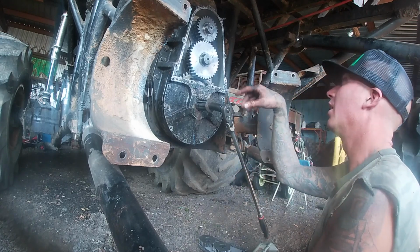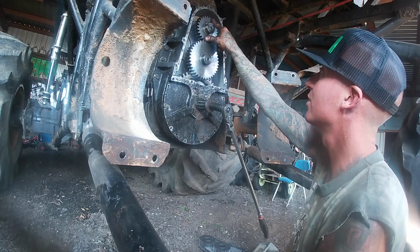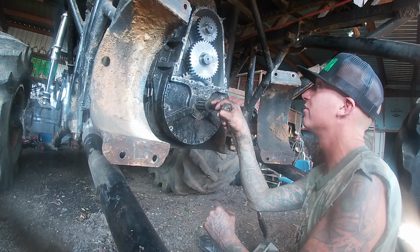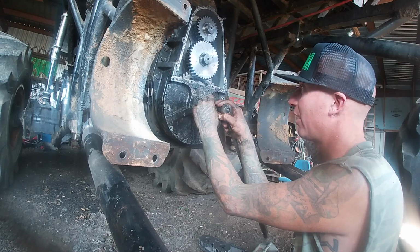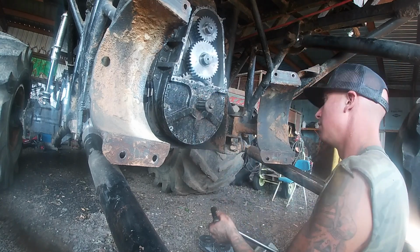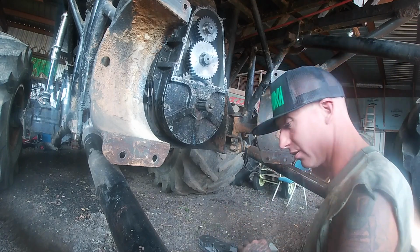So that set will allow me to go 2 to 1 with this gear on top, or 4 to 1 with this gear on top. The other set I had in there was giving me a 3 to 1 final ratio on the case. So this will gear it down some since I'm running the big tires with the new motor. That'll help. Alright, now I'm going to try and put it all back together and make it a little tighter.